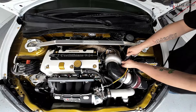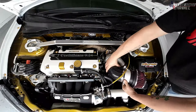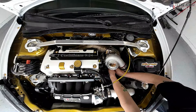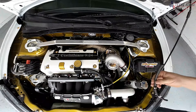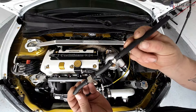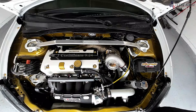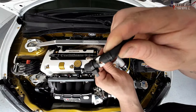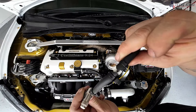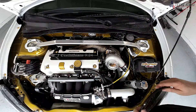We're going to go ahead and take the old stuff off and out of the way to free up more room while we're working. This is the setup we were running on the dyno just to get to 14 pounds of boost — we drilled through on a little tee piece and broke the tee piece off. We're going to ditch this and go with the Mac valve, which will definitely be a nicer option.